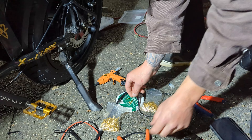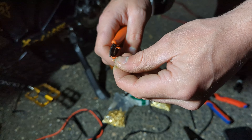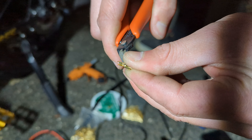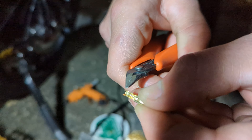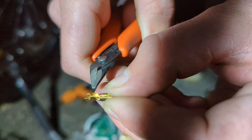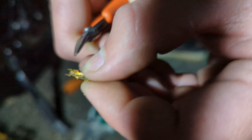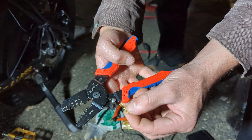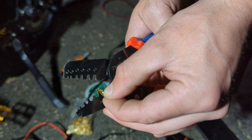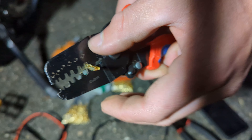If the wires are really skinny, the little tabs on the pin are usually a little too long and can end up cutting the wire when you crimp it, so I trim them down even with the flange. The first flange crimps the rubber insulation — the rubber should end right between the two flanges — and the exposed wire goes in the longer part. You crimp here on the rubber and then crimp here on the copper of the wire.